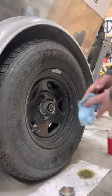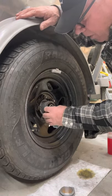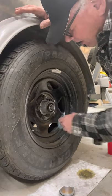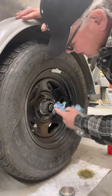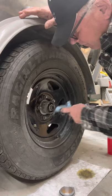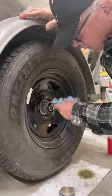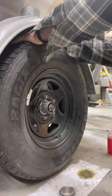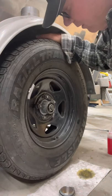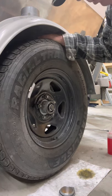When your hub is off, there's a little seating surface for the O-ring in there — you want to get in and do the best job you can cleaning out that seating surface. Also, when you first pull your trailer and get the wheel off the ground, shake it. Make sure it's tight. If you've got over a 1/16" to 1/8" of shake, this is going to turn into a bearing replacement, not just an oil change.